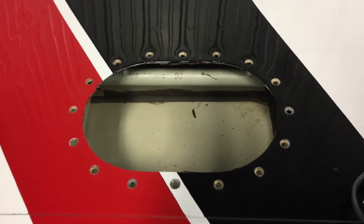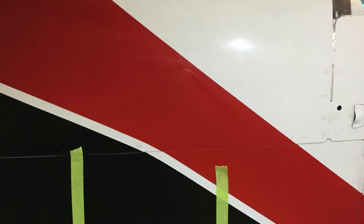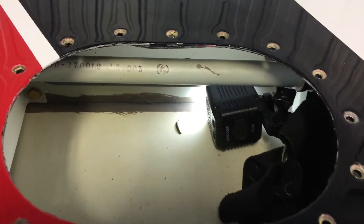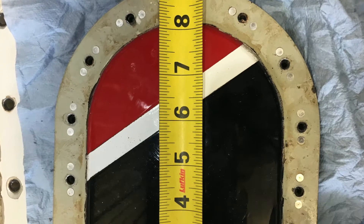That's what I'm going to duplicate the hole for, and this is roughly where it's going to go underneath the wing. I had to pay attention to the ribs and the stringers — these are the rivet lines, and they're kind of hard to see especially on the black paint. That's why I used tape to mark them out, so I lay the tape over the rivet lines to make it easier. Inside is what we're actually trying to gain access to — the back side. The manufacturer didn't install any access panels, and we need to get back there to get to that fuel leak.